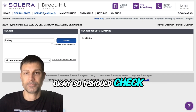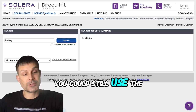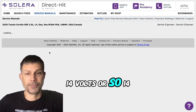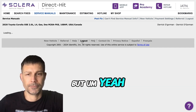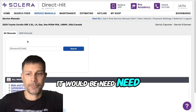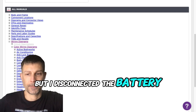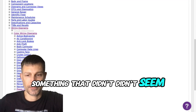So I should check, make sure I have 12 volts? Well, you need to load test it. If that checks out good, you could still use the voltmeter to check the charging system voltage when the engine is running — you're going to want to see it at about 14 volts. I actually checked the battery and it would need to be load tested. I don't have it tested for that. I had disconnected the battery, that resets something, but it didn't seem to make a difference.